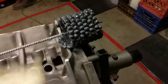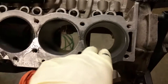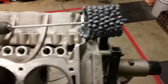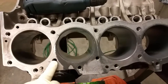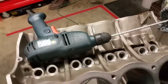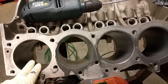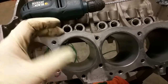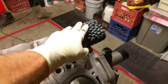It's a very good hone — the flexible balls keep it centered. You don't have to worry about taking too much material off or being off-center while honing because it self-centers in the cylinder by design. They work extremely well for the most common shop task: installing new rings in an otherwise good motor. On modern engines, cylinder rings are made so lightweight that they don't really wear the cylinder — they just lose spring tension, or oil control rings clog and clamp in the piston groove causing excess oil consumption.